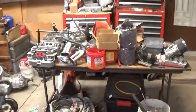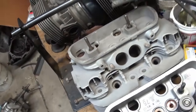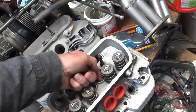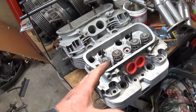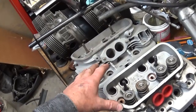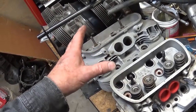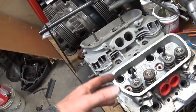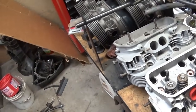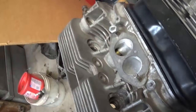There is more to it - I am learning all the time. When you get new heads that have the opening in there, they flow better - a lot better. I was saying in the last video the horsepower is in the heads, and somebody said it's also the cam and all that - well it is, it's a combination. But this head work is like suspension, it's a black art. In the old days they did it by hand, the critical thing being to make each cylinder the same.